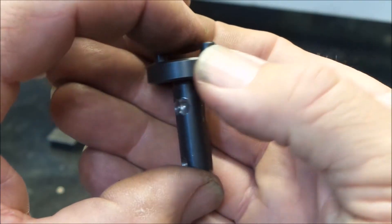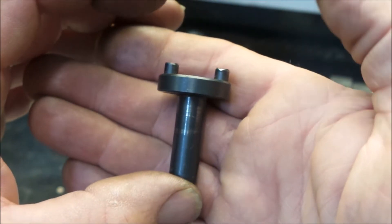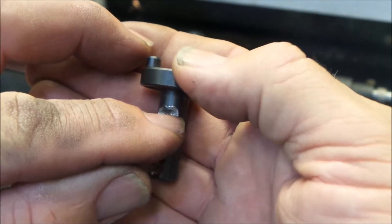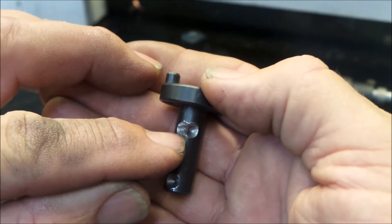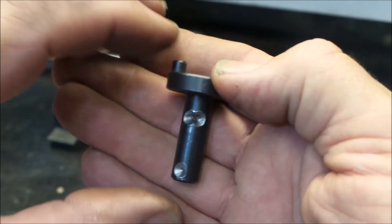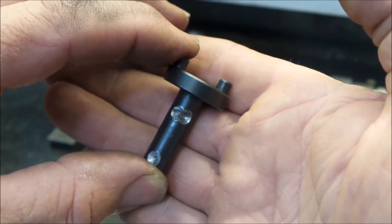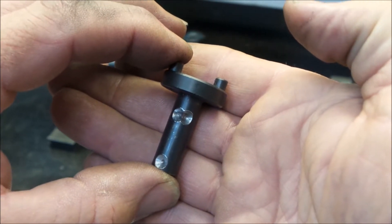Any reason why I can't flip this 180 degrees, re-drill it to where I want it to be, re-drill the detent for the handle, and start again? Because that's just atrocious. It's not even close — it doesn't open fully either. It's sort of half engaged, and when you fully engage it, it doesn't fully engage. Another example of fine Chinese mini lathe craftsmanship. I'll re-drill this and get back to you.